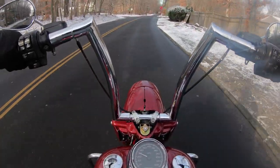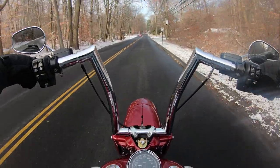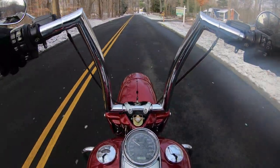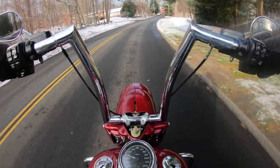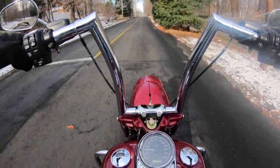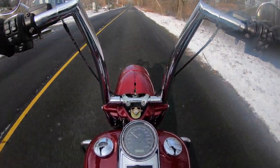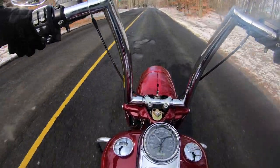The only thing with those slip-ons is he took them off of his 2011 Street Glide and this is a 2018 Road King, so the exhaust pipes are different sizes. On his, they're both I believe one and three-quarters — I may be wrong, feel free to correct me in the comments. On mine, I believe one side is one and three-quarters but the other is two and a quarter, so one side should fit fine and the other won't. I already purchased a reducer adapter that hopefully will work out.